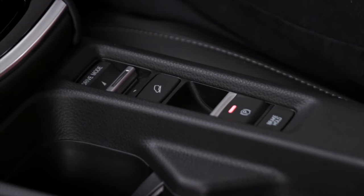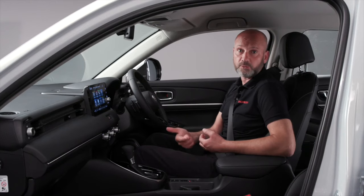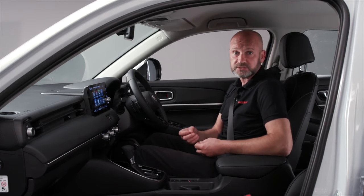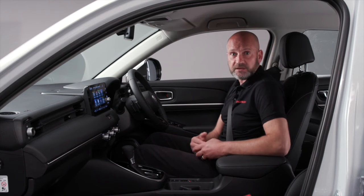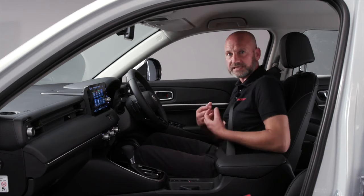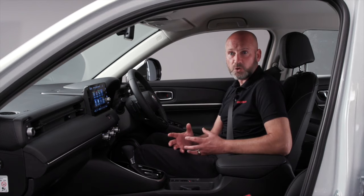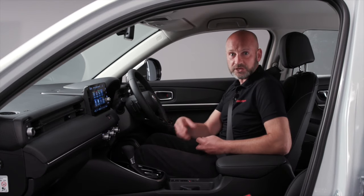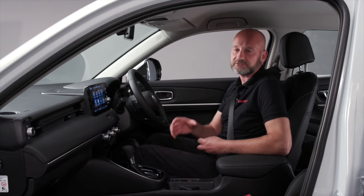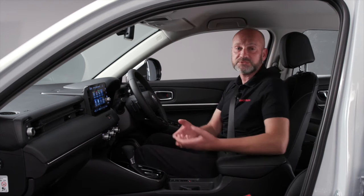In B mode, the paddles on the steering wheel allow you to set the amount of regenerative braking when you come off the accelerator. These only work when decelerating — they give a synthetic engine braking feel with four different levels from light to more severe. You can adjust that simply using those paddles. If you choose not to use them, just leave it in D mode and use the regular braking system. Just behind the shift lever we have a selection of buttons. At the top is the drive mode — Sport, Normal, or Econ. Sport gives a sharper throttle response; Econ softens the throttle response to encourage more economical driving and also allows the air conditioning to cycle less frequently, so you may feel up to a two-degree difference in cabin temperature, but it's your choice between more energy efficient or more temperature efficient.